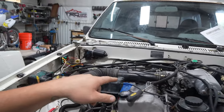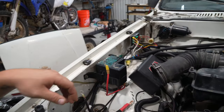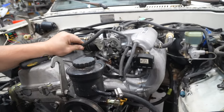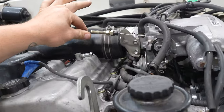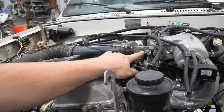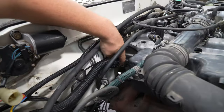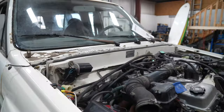We have stuff here coming in today for an intake, custom aluminum intake. It'll put the air filter right about here. What we're gonna focus on right now, we need to get the throttle cable where it needs to go. So pull this off one sec. So essentially the throttle cable mount needs to be, I don't know, 1.5 inches this way. So we're gonna use 1/8 inch aluminum and just make a mount for it. Another place we need a bracket is over here to keep this up and away from the exhaust. We'll use some more aluminum, bend it, make a bracket there.